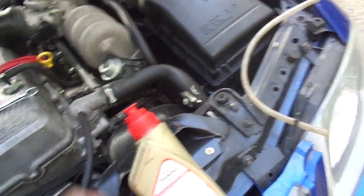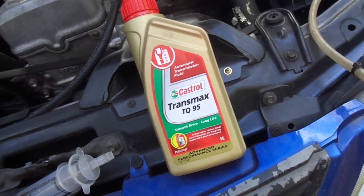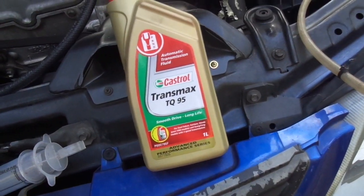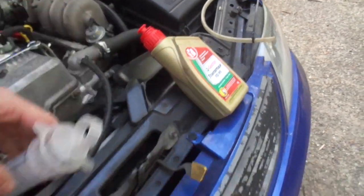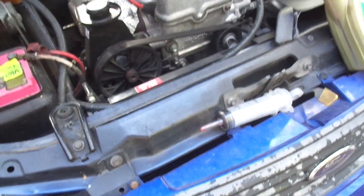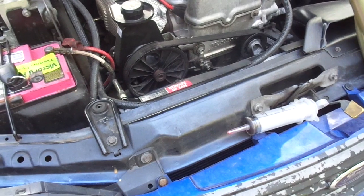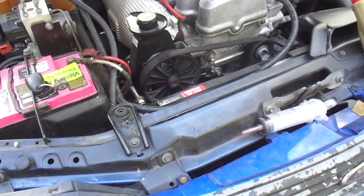What we can do is suck some transmission fluid — I've been using TQ95, the fluid Ford uses now, not standard transmission fluid. Suck it in, shove it in there, and you're filling it up at about 50 to 80 millilitres at a time. I put 250 millilitres in mine this morning and it cured the won't-shift-into-drive problem.